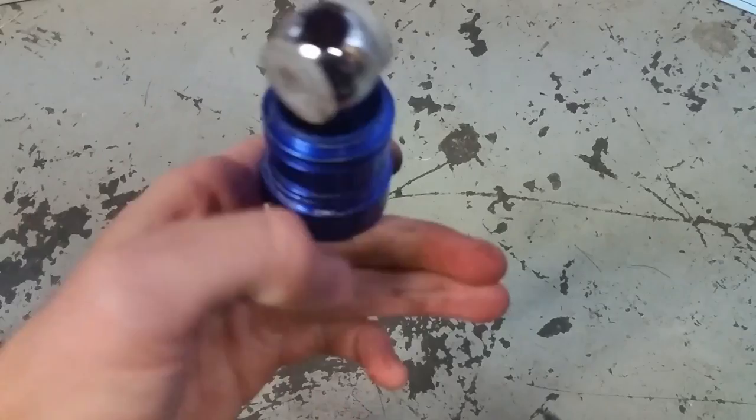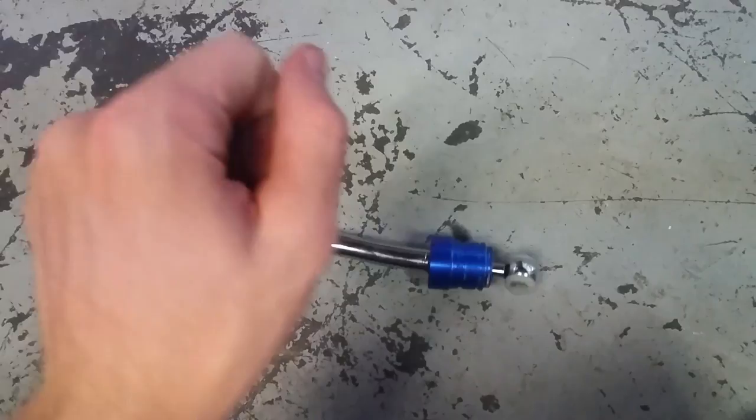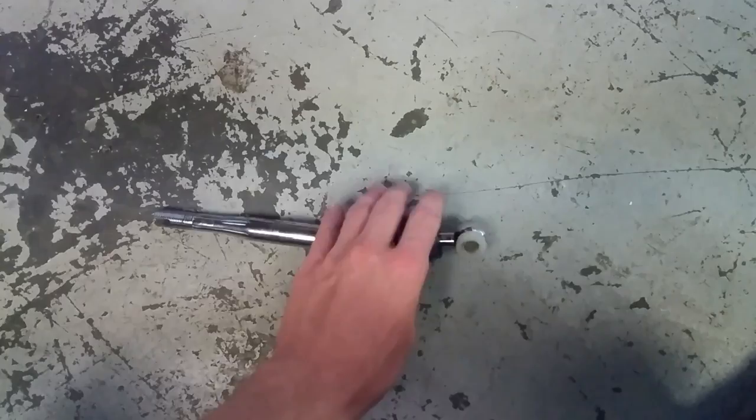There are polyurethane bushings here, and there's no play in the bushing cups. Stock, it'll feel a little mushy — there's wiggle in the shifter. This will obviously vary car to car; my bushings may have been more worn than yours. But when you put this in, you'll definitely notice it. There's so much less play than stock, and it's so much snappier and more precise — something you're constantly going to feel every time you drive the car.